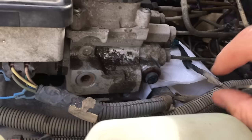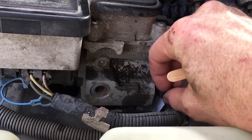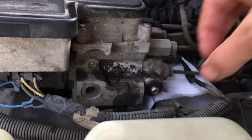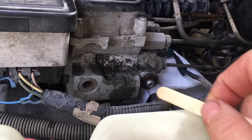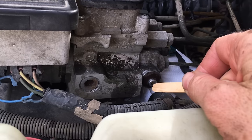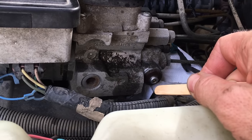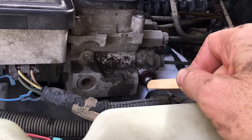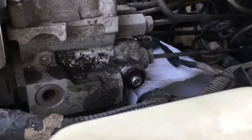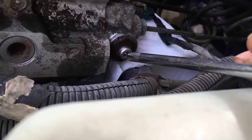I've looked around on the internet and there's some wizards on there that say if you go onto your anti-lock brake module, peel this little rubber cap off with the engine not running, and then have somebody step on the brakes and push the little button in the middle, and fluid will squirt out. Then you let up on it and tell them to take their foot off the brakes, then push the brakes again and release — just like bleeding your wheels, but using this little button. A popsicle stick didn't work, it wasn't pointy enough, so use something pointy in plastic or a screwdriver. I'm going to stick a screwdriver in there.